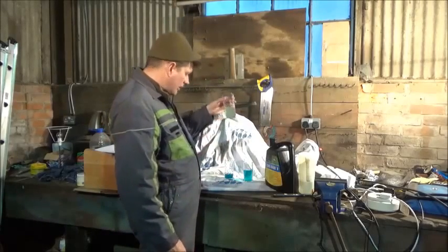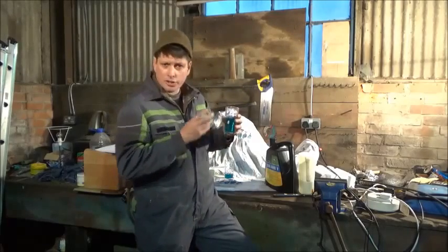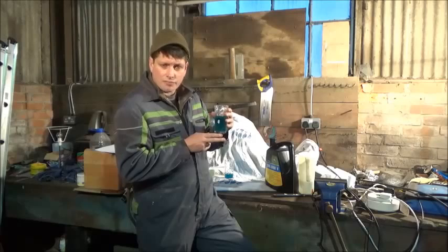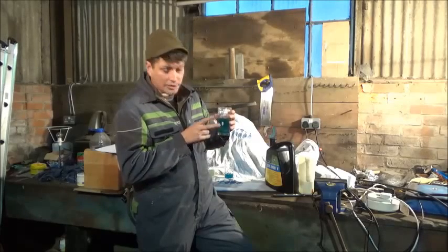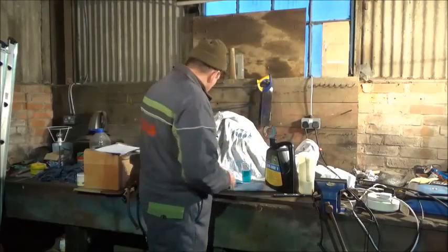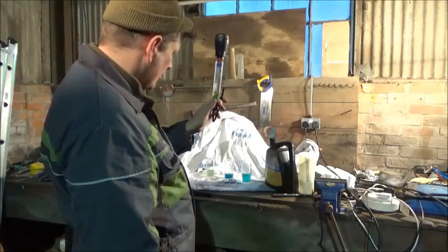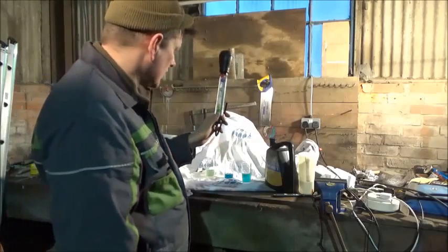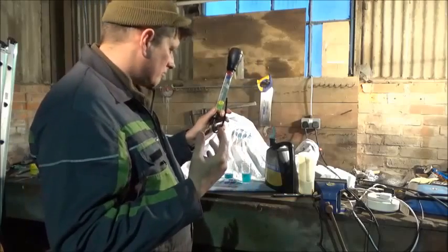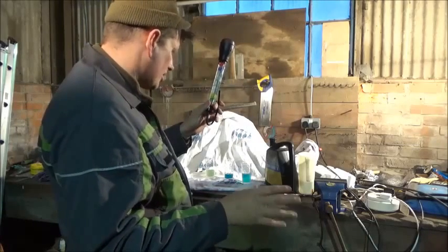So we know the 3350's coolant is good enough for here. This is what we'd normally class as a standard mix - brand new coolant from a main manufacturer's specification, done at one third coolant to two thirds water, which is what most vehicles would run. We'll have a look at that: three discs, so that says minus 10 degrees Fahrenheit, which is minus 23 degrees Celsius. That's what I'd expect to see - it gives coverage for here in England, but in Canada at the moment that minus 23 Celsius would be pushing your luck.